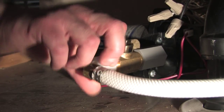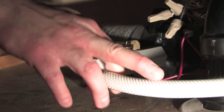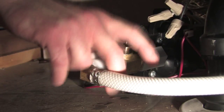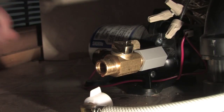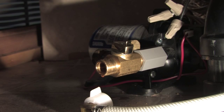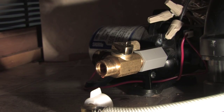Remove the outlet line and inlet line from your fresh water pump — you'll have to drain them manually. The check valve in the pump prevents the air from clearing these lines. Remove any cartridge from any under-sink filter and make sure the fixture is drained. Your fresh water system should now be in good shape for the winter storage months.